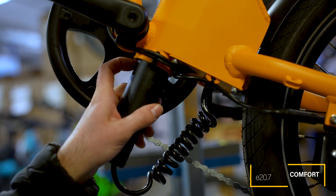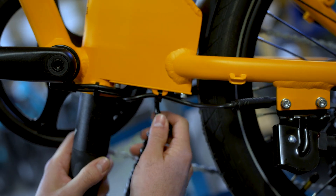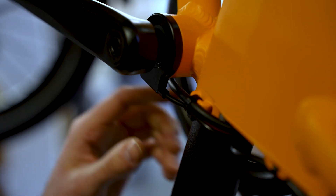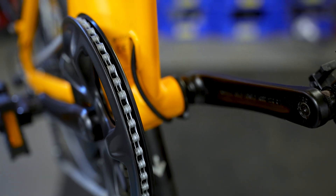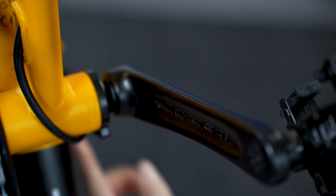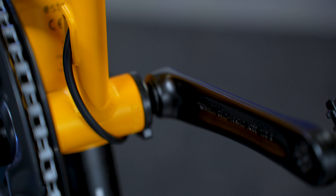There are more cables going into the control box — they're generally always cable tied when they leave us, but just make sure all cables are neat and not hanging loose where they could catch on something. You've got the motor cable, the battery cable, and also the sensor cable — the thin one which runs from the sensor that sits on the bottom bracket. Make sure the sensor is pushed tight towards the frame, sitting snugly between the left-side crank arm and the bottom bracket. The display cable, which runs through the frame, comes out and meets at the same point as the sensor cable into the control box — just making sure that's tight to the frame and that cable ties are still in place.